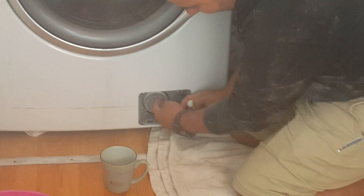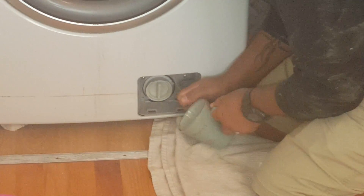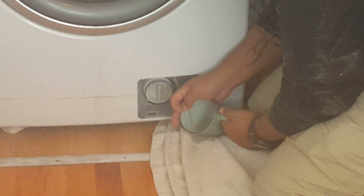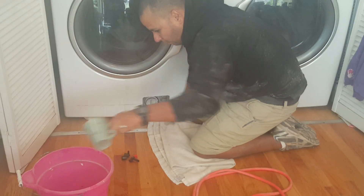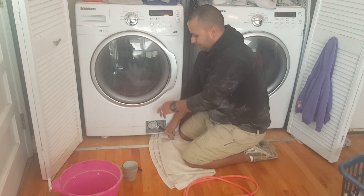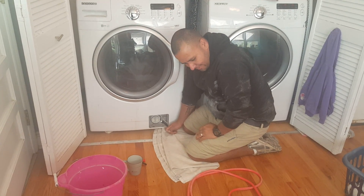So you take out the little plug located up above here and twist it off. Basically what I do is get a cup and take it out — this is the manual method of doing this, and it takes forever, especially if you have a washer full of water. This is mainly when you get the ND sign, which means not draining, right up above here. So I found hopefully a better way.